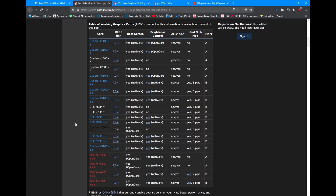For example, the one I would recommend right now is a 780M. Yes, it's a little on the pricier side, but it's a pretty good card. You have a boot screen and brightness control available, and that is not the case on most cards. On lots of cards you can get a boot screen but no brightness control — like mine here, the 765M, which doesn't have brightness control available.